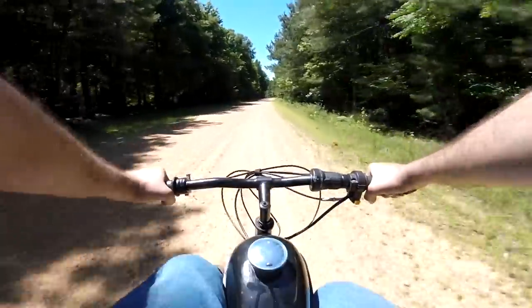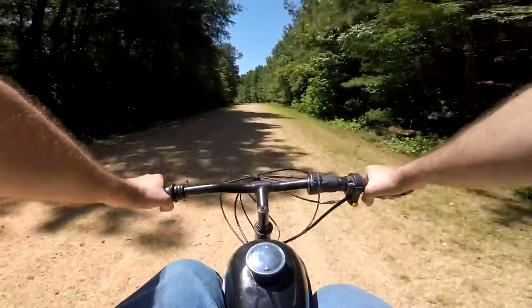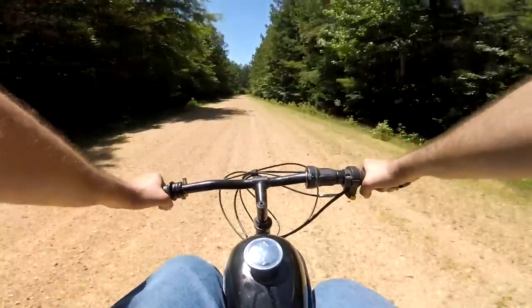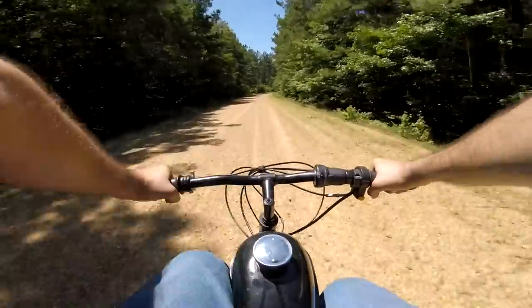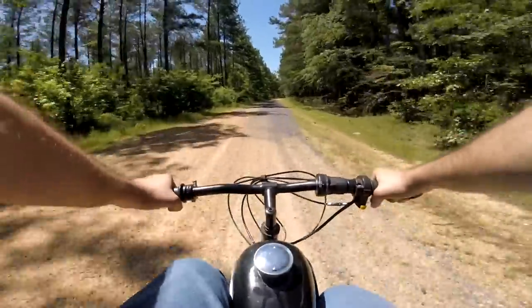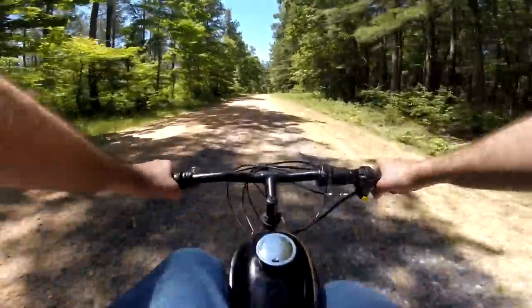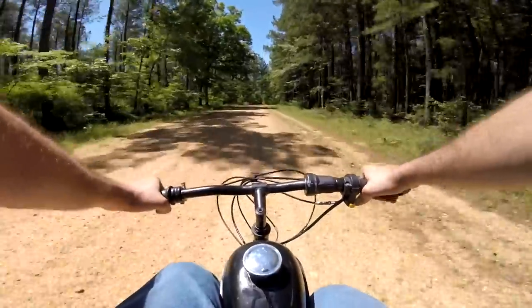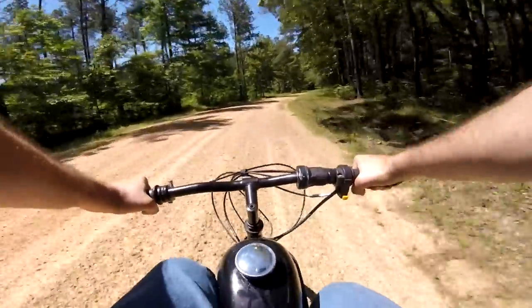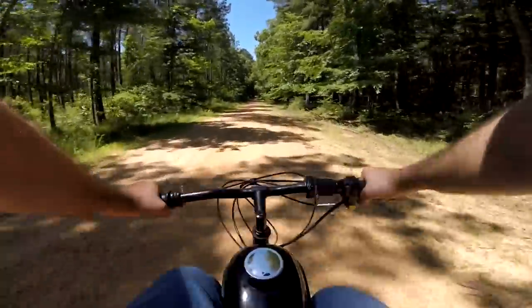Last but definitely not least is what I saved for this section — your perception of speed and distance. In the background of this video you've been seeing me go on a 40 mile round trip with the stock 44.2 sprocket. Don't get me wrong, it was a lot of fun, but when I got home I was fatigued, tired, and just ready to relax. However, when I put the 36.2 sprocket on this particular bike and retook this journey, not only did I complete it considerably faster and had gas when I got home, but I got a lot more comfortable because of the points we've discussed. Not only do you get where you're going faster, but you get there more comfortably. Trips that you might consider to be daunting seem a lot more practical with a smaller sprocket.